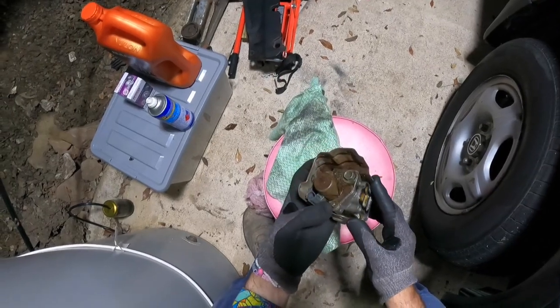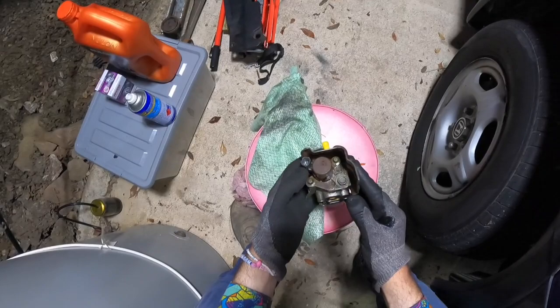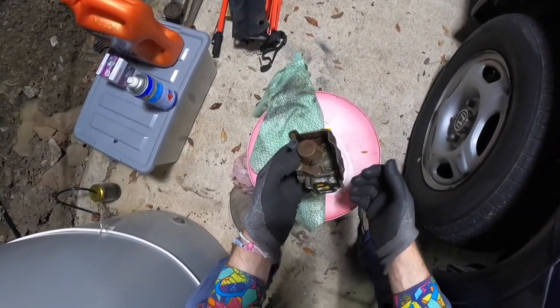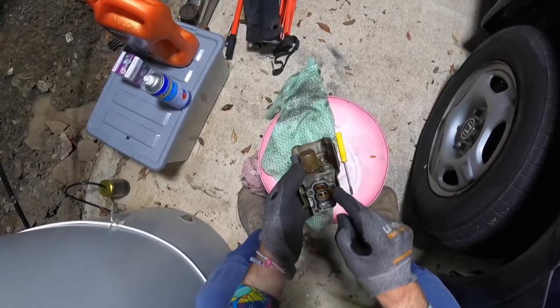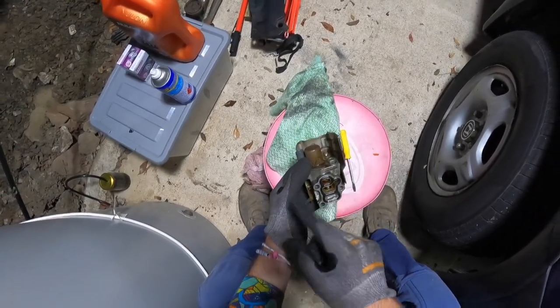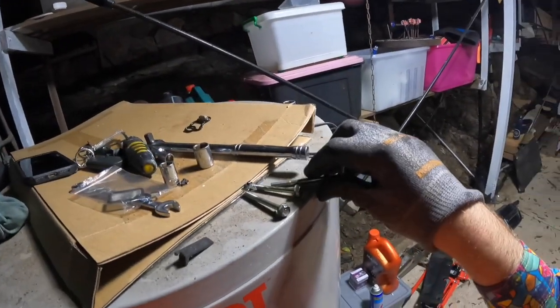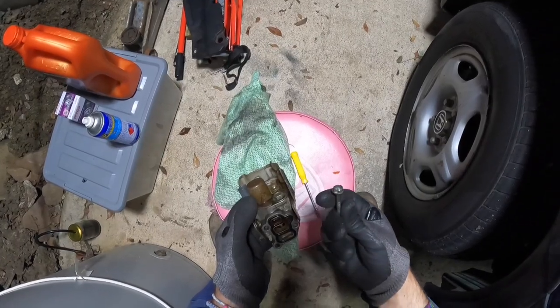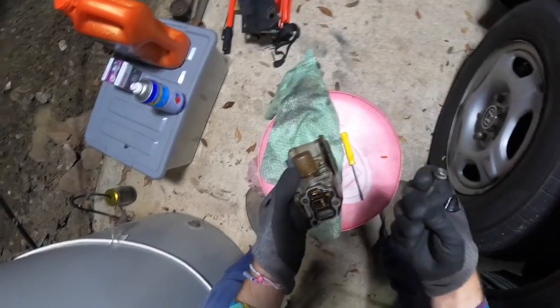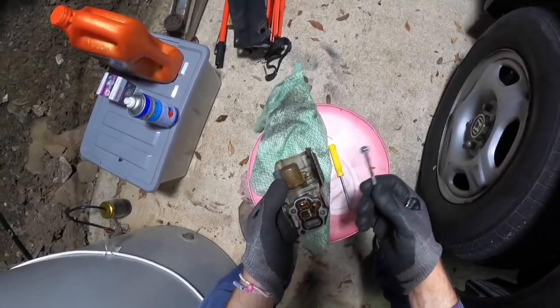So now we're going to put it back on, but it's pretty much just the reverse of taking it off. Set it flat, flush, put the bolts in, tighten it up, just go around like a star, that one, that one, that one, and they're opposites. Make sure they're tight, not too tight, because these threads at the back of the motor get super hot, and they can just strip out. So for next time, just be mindful not to do these too tight.